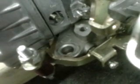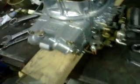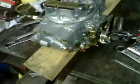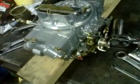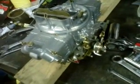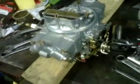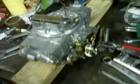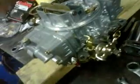Now your idle mixture screws, which are usually on the front of the carburetor, those need to be adjusted preferably 1/4 of a turn at a time, and generally people end up with 2.5 turns out, and they have to be adjusted equally. What you do to one, you have to do to the other. You have to keep both banks of the engine exactly the same, if you want it to be correct.